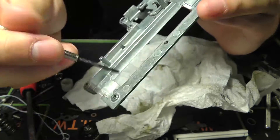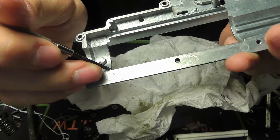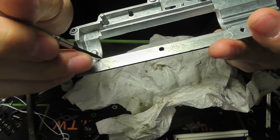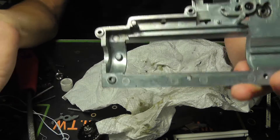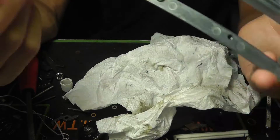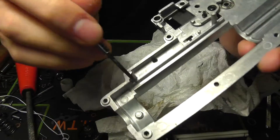Since this is where it rests, it can snap off at that point. So instead of having it at this 90-degree angle, if you smooth it out and make it a radius curved part right there, it has a less chance of breaking. It's not impossible to break, but it's going to be a lot harder for you to break your cylinder head window.